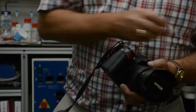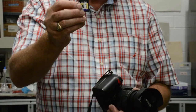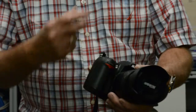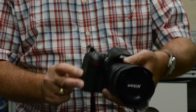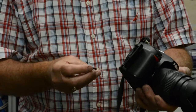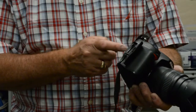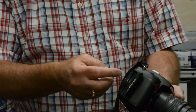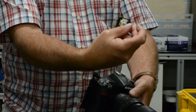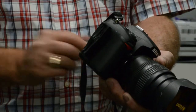For the SD card, the recording device, you can see that one corner is tapered off and the reverse side has the contact points. The port is on the right side of the camera — it has hash marks that you pull towards you, and it's a spring release that opens the port. There are two ports for SD cards, numbered one and two. We're going to use number one. Follow the instructions — it has an indicator with the cutoff corner. Hold the camera so that you're looking at the information side with the cutoff corner at the top left. Insert it and push it in until it clicks. It has a retention mechanism. Then just close the port.